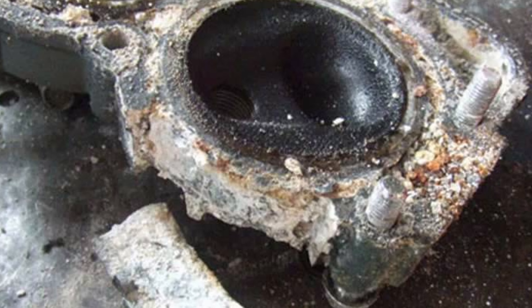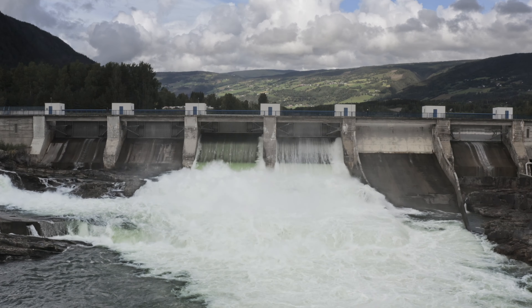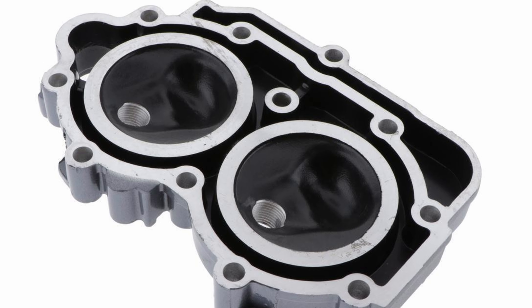When an engine gets hot and cools down, it leaves the salt behind. Here's an old engine that was never flushed — this is the head, and it's one of the parts of the engine that a lot of people neglect. You have to run an engine for a little while when flushing it so that it warms up, because the head — the top part of the cylinder — has a thermostat that needs to open, and water only flushes through once it's opened. That thermostat won't open until about 60 degrees, so if you just run it for a short period when it's cold, the water is never going to reach the top of the head.